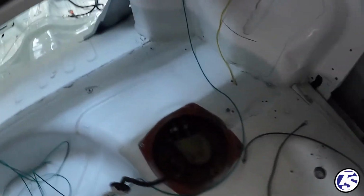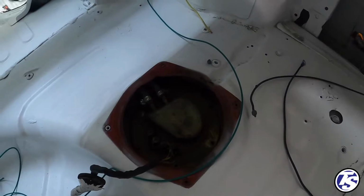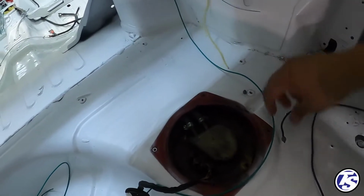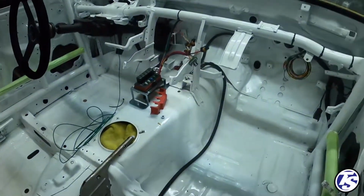All right, so this is the old tank. Go ahead and pull that out. Put in the new tank that we had modified, and this is going to be our fuel pump wire, power, and then obviously ground it, and then we'll go ahead and make it clean there. And that should be the last circuit on this fuse box that I need to do.